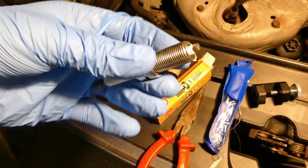If your car has a pollen filter, it's behind this insulating material which has a few retaining clips. I'm using a trim removal tool. There are three of these clips, plus one clip down there that's a simple plastic twist-type. The insulation material can then be taken out.